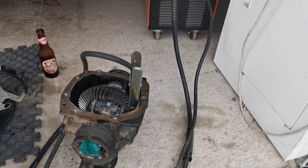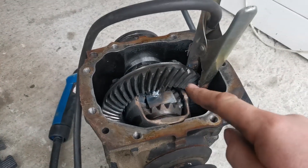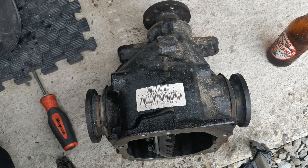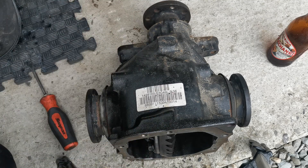We're going to do that all the way around. I've done that quick weld around the rest of the plate and that should lock it in there pretty good. She's all welded up now, plates all in. I'm going to put the back housing on and put some oil in it. I've given it a good cleanup and got all the extra splatter out of there so it's not going to wear down the gears.